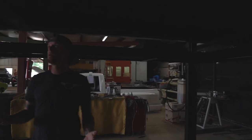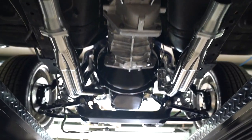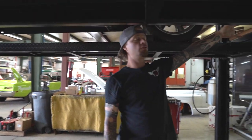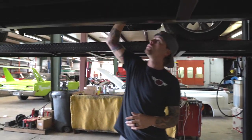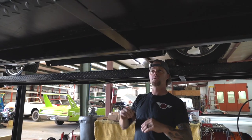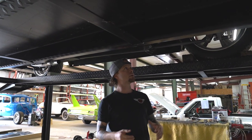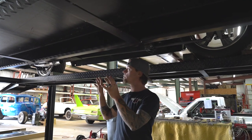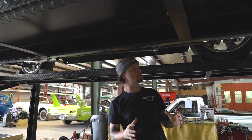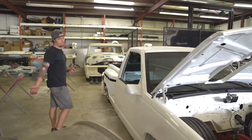The body's painted and we've got these huge wheels and tires under here. When we were building this car we knew we wanted it to be low and tuck a lot under there, so we back-halfed the car — we've got our back-half frame section in. We're waiting on a fuel cell, about to hoop it for our driveshaft, and then the owner wants a rubberized undercoating since he plans to drive this one a lot. We'll get it finish-fabbed, cleaned up, undercoated, and then get the interior finished up.